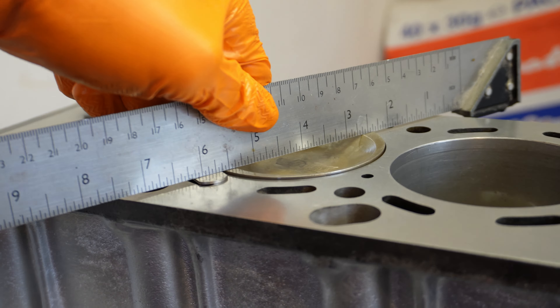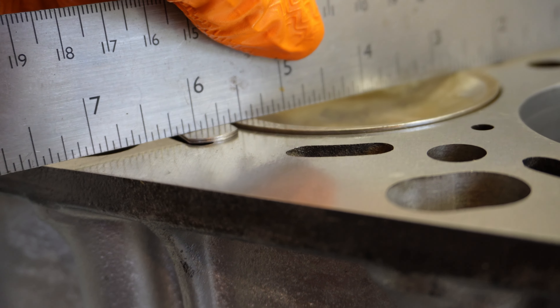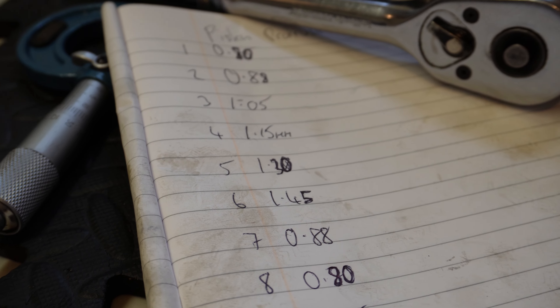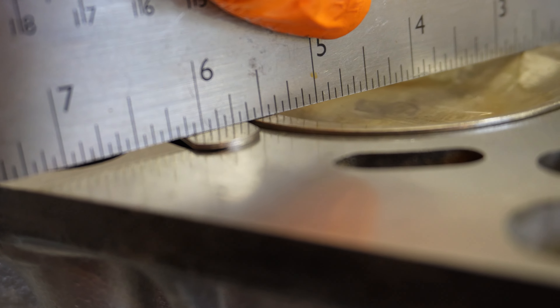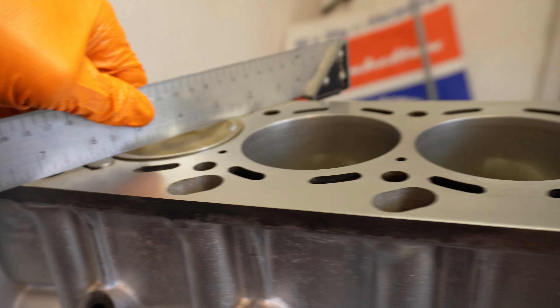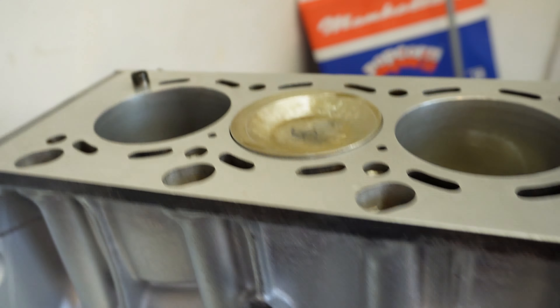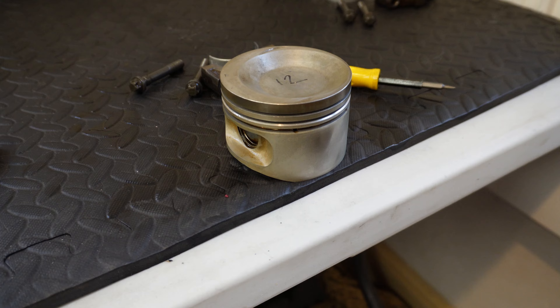Full disclosure - I wasn't using a dial gauge to determine piston protrusion, just feeler gauges, but they're 98-99% accurate and give you a very good idea. My notes show 1.3 is cylinder 5 - with 1.25 on the feeler gauge stacked together, and this is piston 11 showing that level of protrusion. It's very clear they're all way off on cylinders 3 through 6. I've actually removed piston 6 already because I've started the process to get this rectified - I also have number 12 taken apart. I swapped piston 6 into cylinder 12 to see if it made a difference, and the protrusion is exactly the same - there's no difference in conrod length, and bearings have zero impact on the measurement either, so there's no question this deck is off.